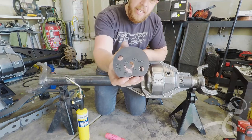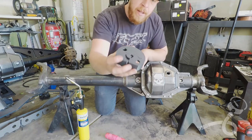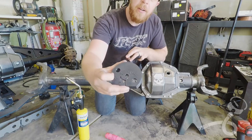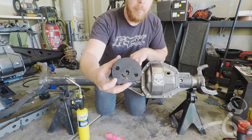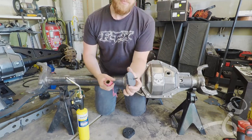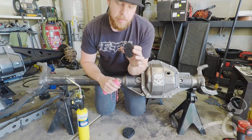I've got these indicators here with little steps that tell me how far out of round or out of straight the axle is. And mine actually still lives in this quarter inch right here, but it is barely touching the edge. So it's not quite an eighth inch out. I mean, like you say, it's not bent a lot, but let's give it a shot. Let's see what happens.